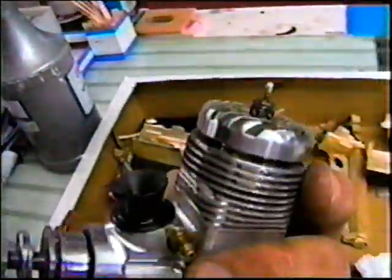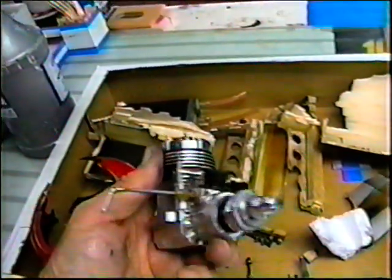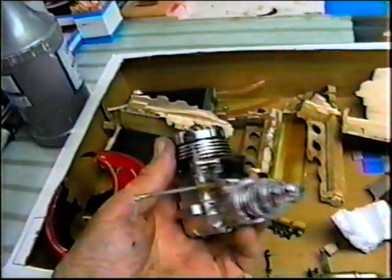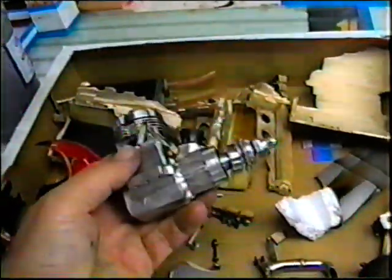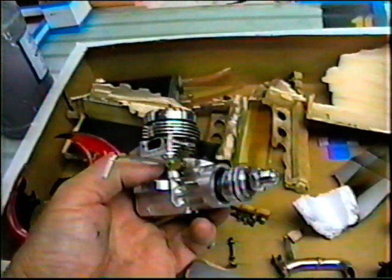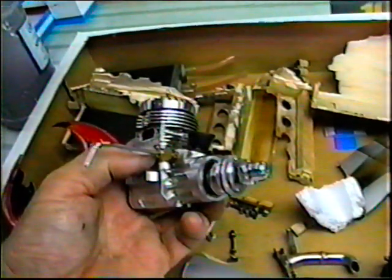What I did, I cleaned up the motor, made sure I don't have any problems with it, took the header off, just took it out on our test bench outside, and let it run for a tank of fuel. So apparently there's no damage at all to the engine, and so this engine will be ready to replace the crankshaft. As soon as time permits, again, I'm doing this piecemeal one day at a time, I guess the first thing would be to establish that we have an engine, because the only engine that we can run with a reverse crankshaft is the bar stock road jet.